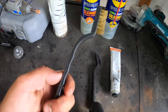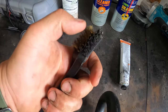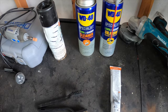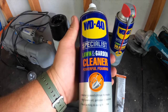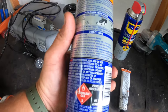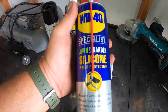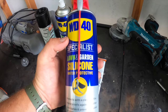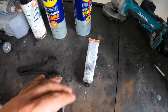First off, I just bought a couple of these from Bunnings. These are little packs - you can buy soft bristle brushes in different textures and softness for doing different areas, but I like these because they help me clean the blade system. For the blade system I also use WD-40 products and Stihl products. The first one is an actual cleaner - the WD-40 lawn and garden cleaner. It foams up, you shake the bottle, spray it on, leave it sit for a bit, then give it a good scrub and clean it off.